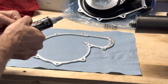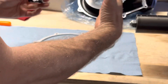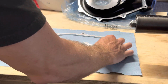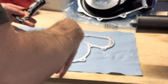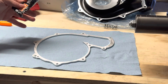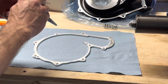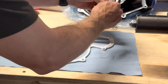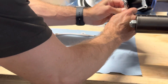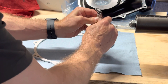We don't want to get too heavy with the gasket maker. If we put too much on and compress everything back together, we can have excess that pinches off. Over time, with boost pressure building up, those pieces can break off and get sucked through the engine — definitely don't want that. So we just want to use as light an amount as possible and smear it with our finger.